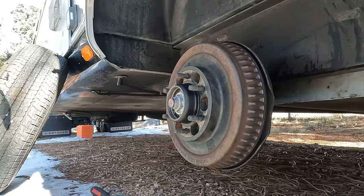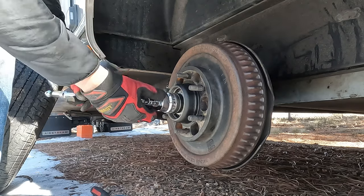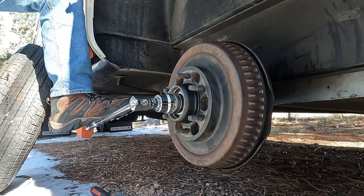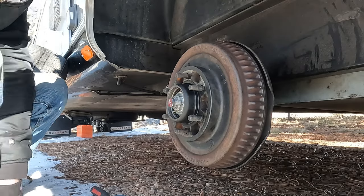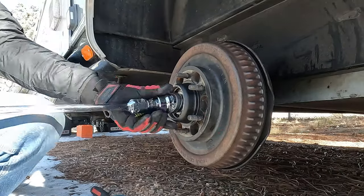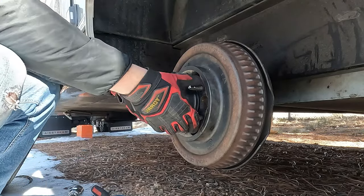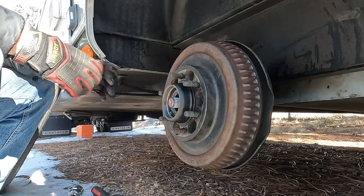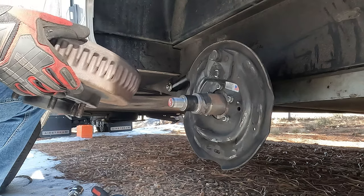We do need to take that nut off. That is a 1 7/16. First time you take that off, it's going to be tough. Probably a breaker bar extension. I didn't torque it, since I've had this off and I knew I wouldn't be moving it. So we got this replaced. Washer. And that rubber just comes right up. Okay. Telling the camera what's going on. Oh, like that.